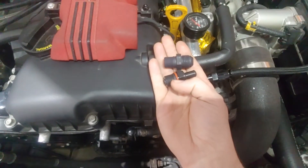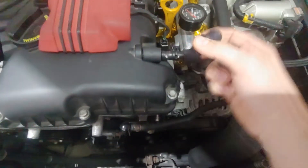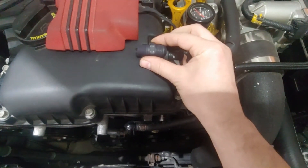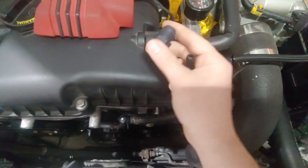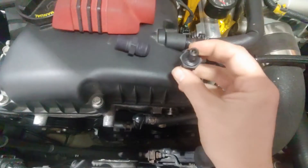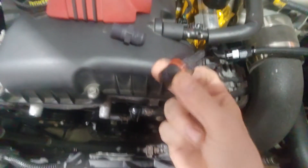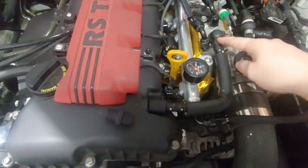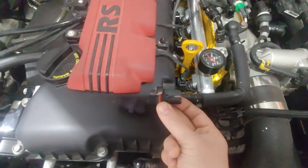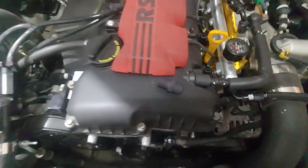What you have to do is take the o-ring off of your stock PCV and put it on to this one, and then it just threads right back in. This converts it to a dash-8 AN, which makes the ID much larger for a lot more flow, and it gets rid of that little valve so that when you build boost it doesn't pressurize back into the head — essentially that valve will close.